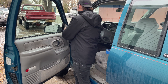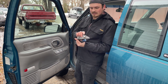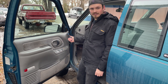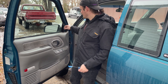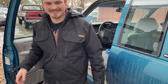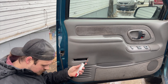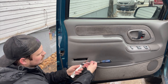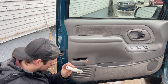First things first is this guy right here. All you got to do is get behind it and pull straight out. It's got one clip and two tabs on the bottom, so pop the top out and then lift up. There's a plug here for the light switch — I've seen videos that tell you to take it out, but you don't actually have to. It's not connected to anything and doesn't hold the door on, so don't worry about that piece. This light comes off super easy. Get behind it on the end, pry it out. There's your electrical connector. Use a small flat blade screwdriver — there's a small tab, lift up on it and just pull out. That light bulb fell off.